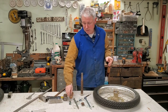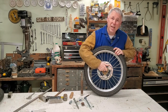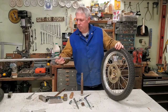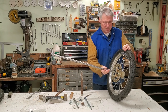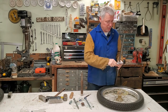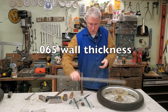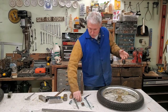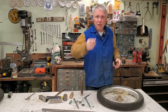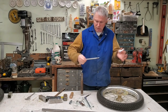The one problem I had was spacers. It came with these two little spacers and this big axle, but they're not taking into account that this hub has a little flange right in the middle. Luckily I had a pipe here that fits right in — it's three-quarter inch tubing, a little thin-walled, not as thick as I'd like, but I'll use that for my spacer. Unfortunately the original spacers are only nine millimeters wide and the replacements came at ten, so that's two millimeters longer than I need.